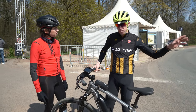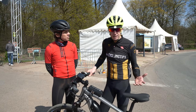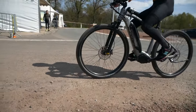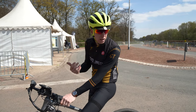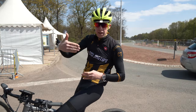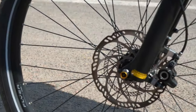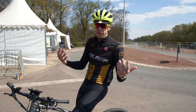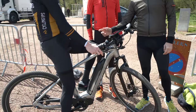It wouldn't activate all the time. I was just rolling around here and you can feel it doesn't really do much if you just lightly hit the front brake. It's not going to engage all the time — it's just like with your car. Your ABS only engages when you really need it, when otherwise your tires would be squealing and skidding across the road. So this is exactly the same thing — it only activates when I slam on that front brake, and it only works on the front brake because there's almost no braking power out of the rear anyway. Anybody who's ever had to use their ABS in a car — anybody who lives somewhere where it snows — you can feel it through the brake pedal, kind of jiggling and wiggling at you. Same thing here. You can feel clearly something is happening with the hydraulic pressure inside this box. It's essentially what you would do as a very skilled cyclist — feathering that brake — but it's doing it for you automatically and far better than I could ever do on my own.